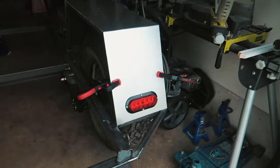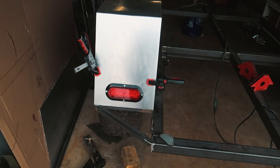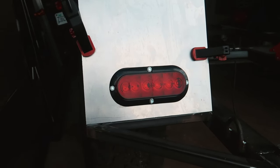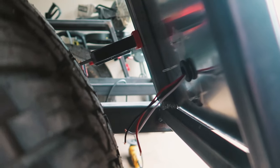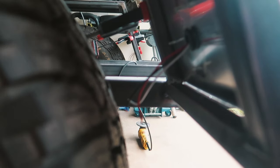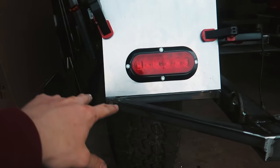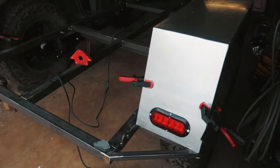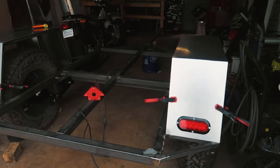While I had these fender skins on, I figured I'd go ahead and get my taillights in there — I'll link these in the description, I got them off eBay. All I had to do was mark and drill the four holes, and on the back side the wires stick through. I used a rubber grommet, used a step bit and drilled a three-quarter inch hole. Once I get my other wiring done, I'm going to cover that with armadillo covering — it's right behind the tire but it'll be perfectly protected. This is just the mock-up, so when it comes time I just strip it down, paint it, and put it back together.